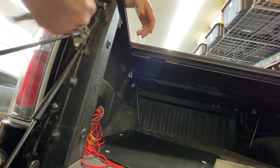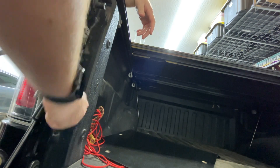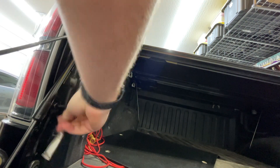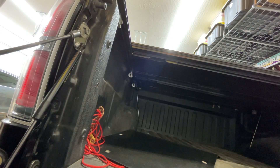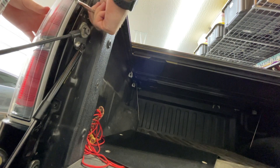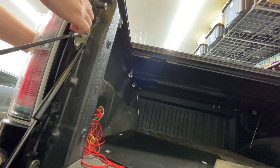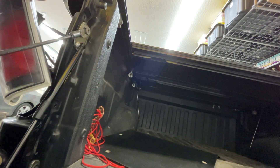Here at the back of the truck, we should need to do nothing more than remove these two 8-millimeter bolts and basically push the taillight back towards the back of the truck. We're going to try that here in real time — there's bolt number one and bolt number two. This taillight is getting awfully loose. And there we go, taillight's free.